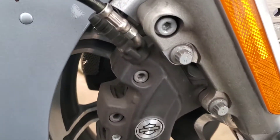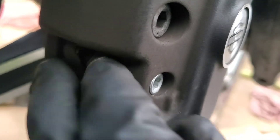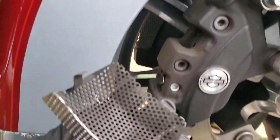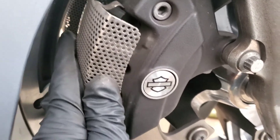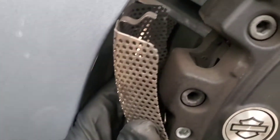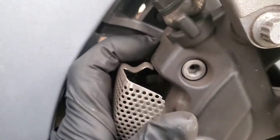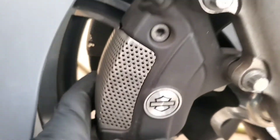Now I put this cover on, but I'm not supposed to put that on yet — first you have to put your new retaining pin in. Right where that bolt is, there's kind of a little shoulder here — it's really tough to see, but you want this pin to go right in where that shoulder is and it should pop right in. You should hear kind of an audible click as it goes around the little ridge that holds it in place. Then we're going to put the cover back on here — put those pins on the bottom in there and you'll feel them go right into place, then clip the top part forward. Give it a little wiggle and make sure it's tight and not going to fall off.